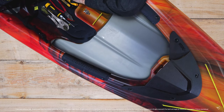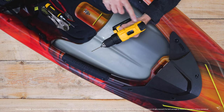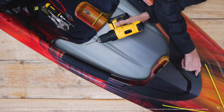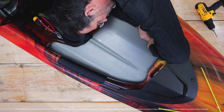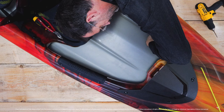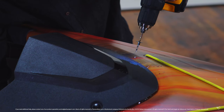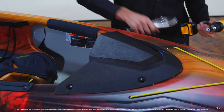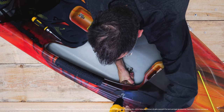The first thing we have to do is remove the broken visor. To do this we need to drill out the rivets holding the visor in place. Use your pliers or vice grips to hold on to the underside of the rivet to ensure it does not spin and the drill actually cuts through it. Insert the drill bit into the hole at the top of the rivet and carefully drill it out.